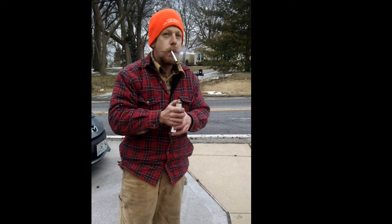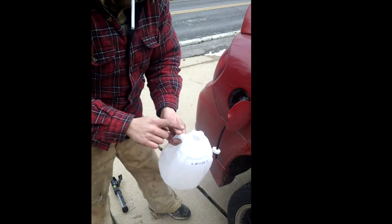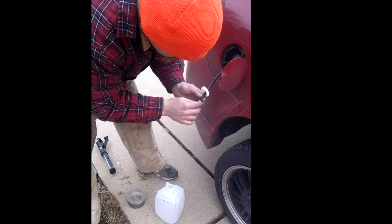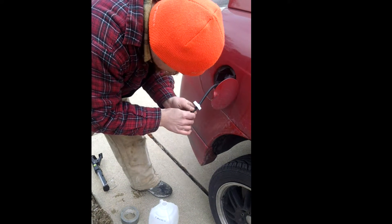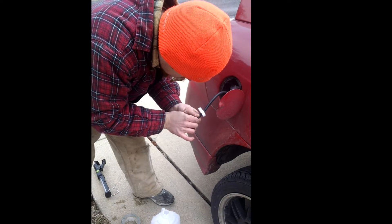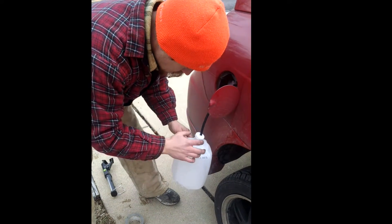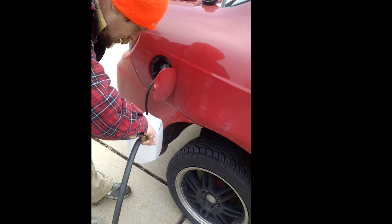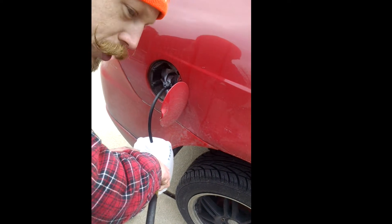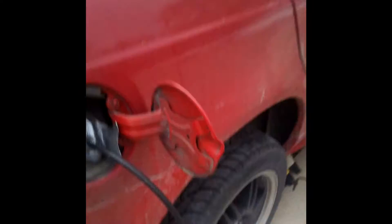Phase two: light up a cigarette. Put the hole here at the cap, then insert it into your fuel line or whatever else you feel like using — some people use cigars. Screw it in there and start pumping smoke into the system. Watch it all come out of the gas tank area. Send someone underneath the car to check for smoke leaks and see how it works.